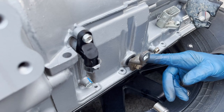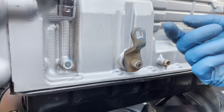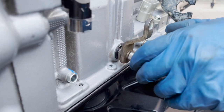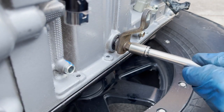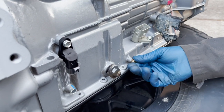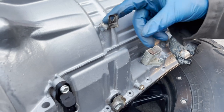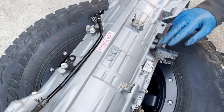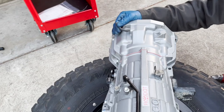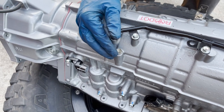The shifter lever can go only one way because it's got an oblong slot - you have to have the S-shape facing outward. I don't have a torque spec for this so I'm going to use that German spec - good and tight. We also swapped over the wiring harness brackets, the bracket for the transmission cable, the breather hose, and another bracket bolt from the old transmission. The new transmission is now ready to go.